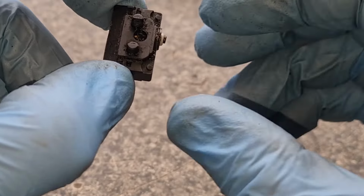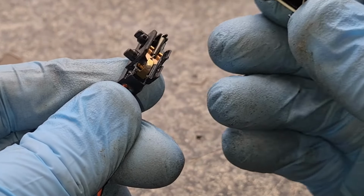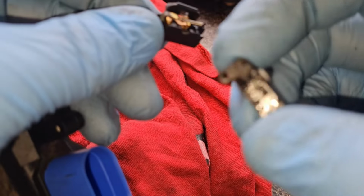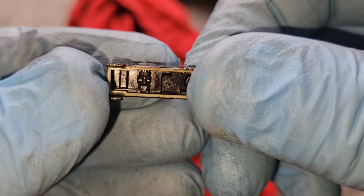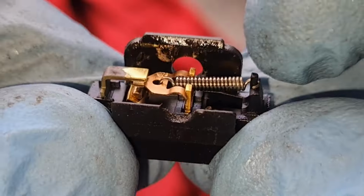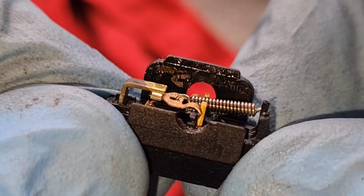Out of the way. Now I want to see what it is that we've got inside here. So gently, in case there are any springs or anything else like that in there. Okay, so there's a little micro switch there, and what happens is this tiny little button here on the other side pushes down, and it actually pushes down on that spring, so that when you push down on the spring, you can see the switch being activated, just like that.